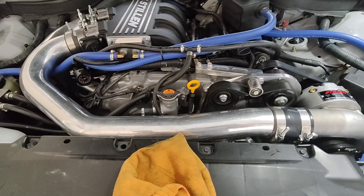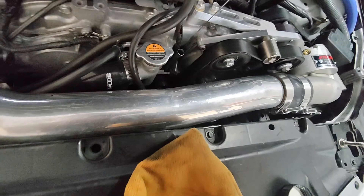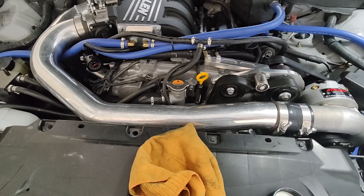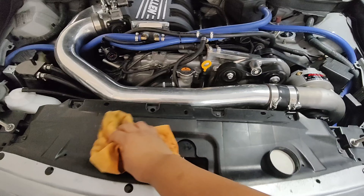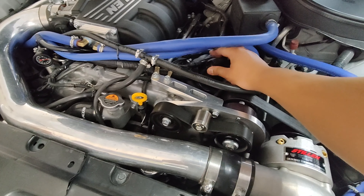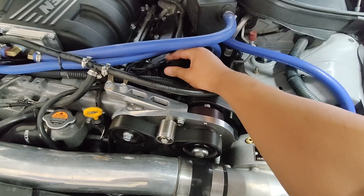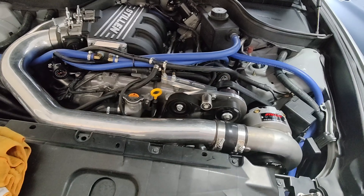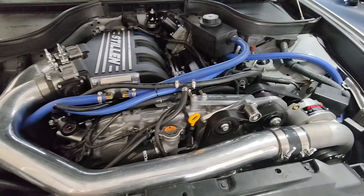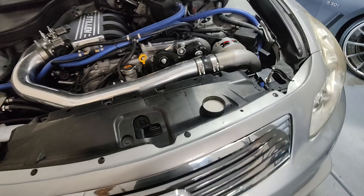That's all preference — if you guys want to do that, it's up to you. What I'm gonna do is just add oil, run the car, and maybe change it a little sooner than I did this time. So just keep that in mind guys. We just finished filling up the oil. I like to put just a little over the full mark because if you don't put oil into the filter, that level's gonna go down anyway. I'm gonna start it now for like three to five minutes, let it warm up, and then see where the level is. I don't know if you guys have this problem but this oil cap is really hard to take off sometimes — I just hand tighten it to where I can undo it because sometimes I need vice grips to loosen the oil cap.